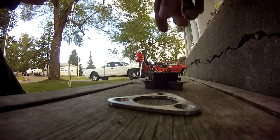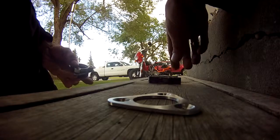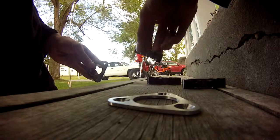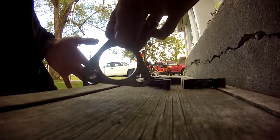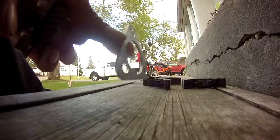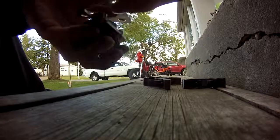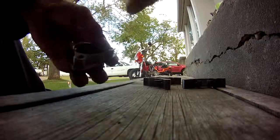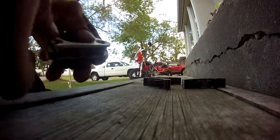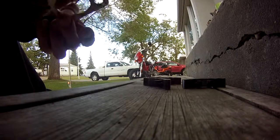Okay, we're playing with the second year of Tomos hammer clutch, and I've got 3 shoes here. 1, 2, 3. We've got the hub without the backing plate on, and just right off the bat, this might be hard to see on the GoPro, these sides are unfinished. When you do get in here, they're countersunk, so it shouldn't matter too much, but those holes are a little bit wider than the countersink. So you might want to clean those up at the same time.